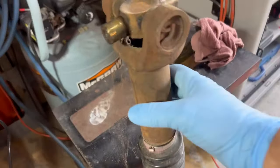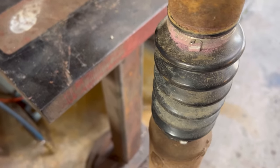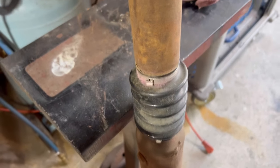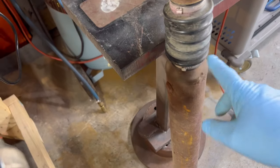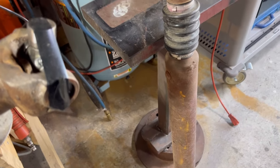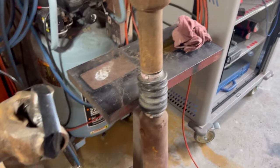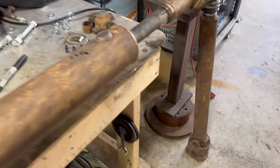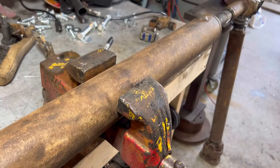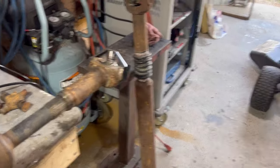With this one extended all the way out it's just barely 42 and 5/8 inches, so I'm gonna carry it with me and he may just cut the ends off and add a piece of pipe to get the right length. That's where I'm at on the driveshaft, and that's probably it for this video — it took me a couple of days to make it.